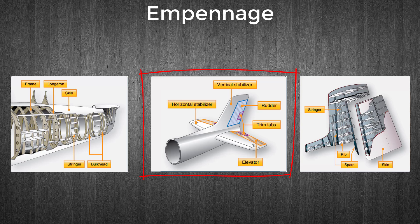The structure of the stabilizers is very similar to that which is used in wing construction. This figure shows a typical vertical stabilizer. Notice the use of spars, ribs, stringers, and skin like those found in a wing. They perform the same functions: shaping and supporting the stabilizer and transferring stresses. Bending, torsion, and shear created by air loads in flight pass from one structural member to another. Each member absorbs some of the stress and passes the remainder on to the others. Ultimately, the spar transmits any overloads to the fuselage.